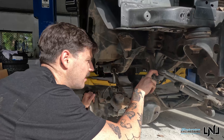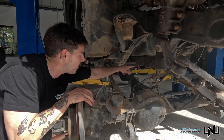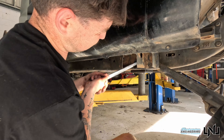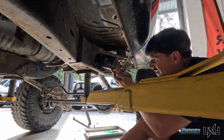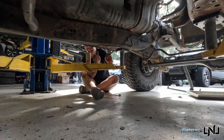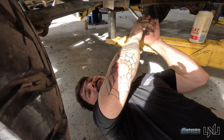We're just taking the drag link and panhard nut off, knocking those two out, then moving up to the radius arm bolts — take those out, then the brake line, and the whole diff drops out. One hour later, last radius arm bolts out and then the diff comes out.